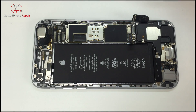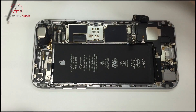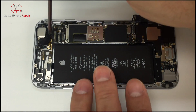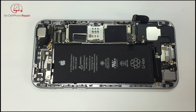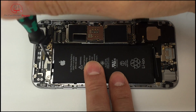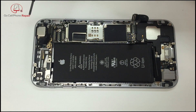I'm going to leave this screw in place for the moment and start up here towards the top end of the phone. There's one screw that has a very large head — it's very easy to recognize because it's different from most of the others. Just to the right of that you'll see there's a standoff screw. The best way to remove this is with a standoff screwdriver; if you don't have one, a fine-tipped regular flat blade will work also. From here we have a couple of screws that come out from this cover plate, which has a couple of flex cables beneath it that will need to be disconnected.